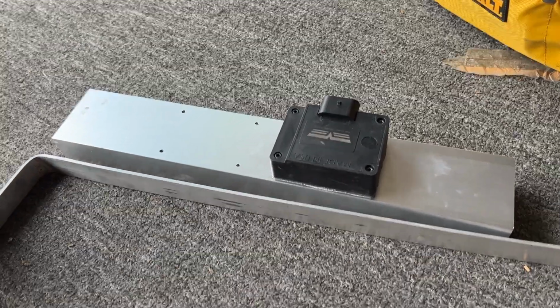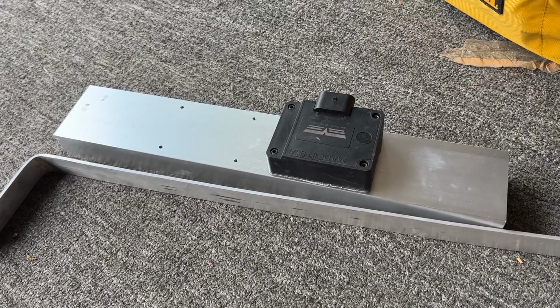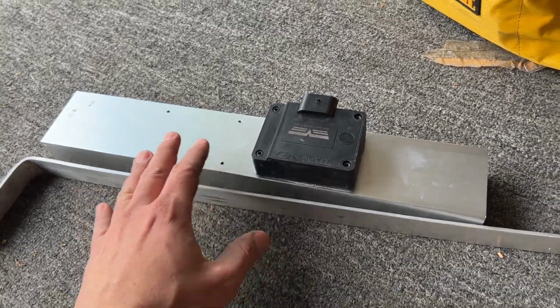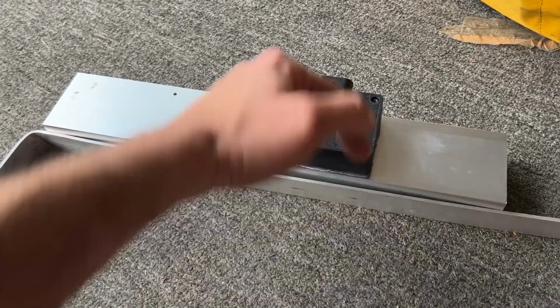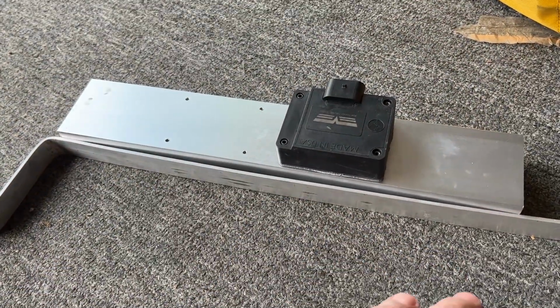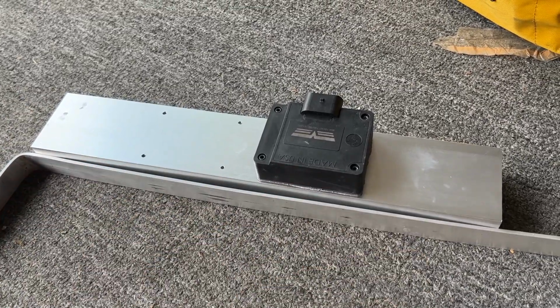And then we're gonna have the battery tie down bolted down to the 2 spots, and that will all together be really nice and firm. If I was to keep this, what I would do is put it against there, drill 3 bolt holes, add bolts, and then lock nuts on the bottom, or I would just tack weld it in a few spots to keep it in place.